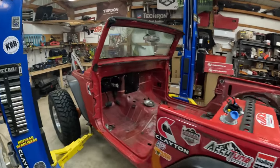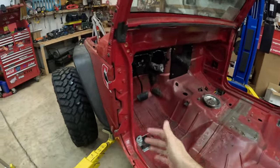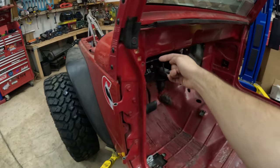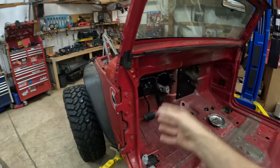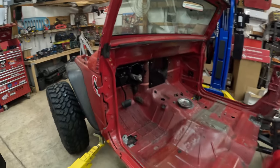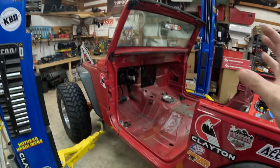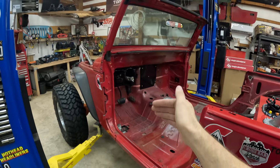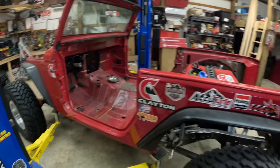The second goal is to build the roll cage to be removable until final assembly. That's going to help us make sure we can get in and weld the backside of the tubes, full penetration, really good welds, and then we'll be able to paint it at the end because nobody wants a rusty roll cage. It is a little difficult planning out a removable cage that in the end is going to be fully welded, and we'll talk about the plan for that.